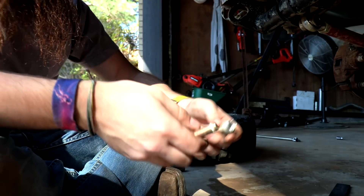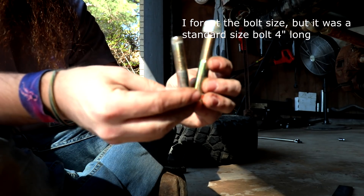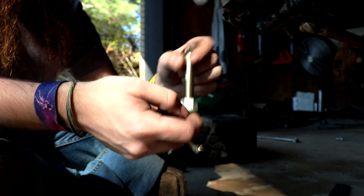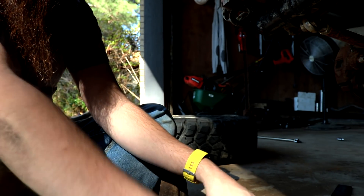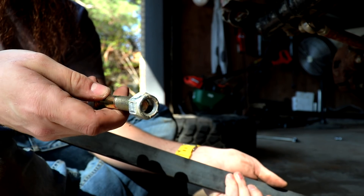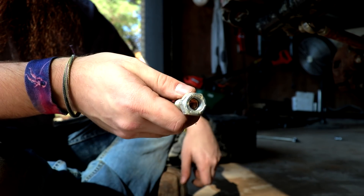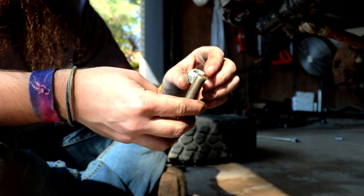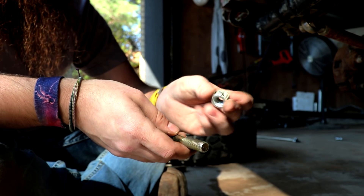I swung by the hardware store, got some bolts — I think they're gonna work. Grabbed some washers to go along with it and some rebar to weld up for a little reinforcement, to keep the plate from bending and flexing. This is the longer bolt I got for my traction bar — it's the same grade as the original, a good strong grade-10 bolt. With some washer stacks that bracket is gonna work. I can run the bracket through there, still bolt the nut up to it, and still have plenty of thread engagement, because that's one thing you don't want on any kind of suspension — you don't want to use just a few threads of engagement. If this thing has every bit of threads engaged, you better get all your money's worth out of that nut.